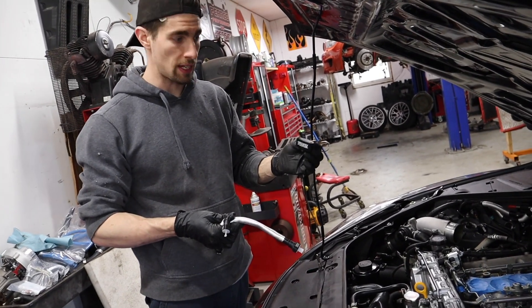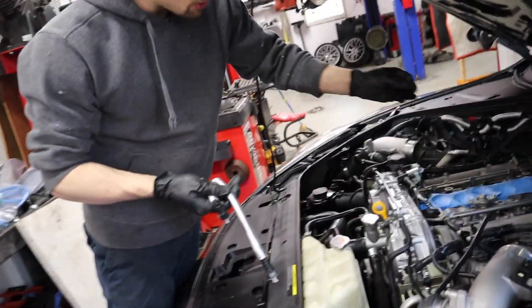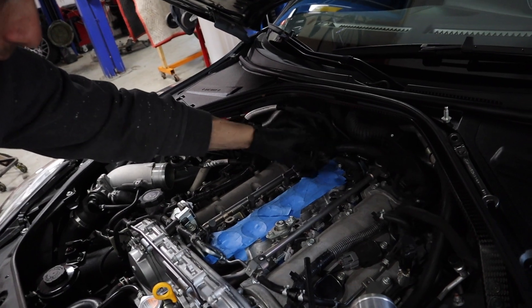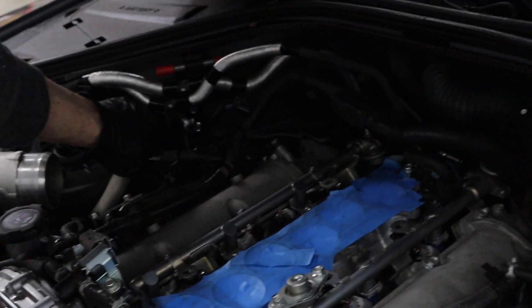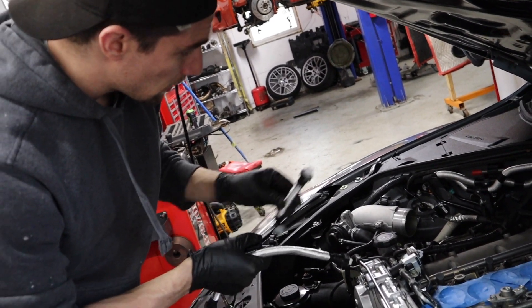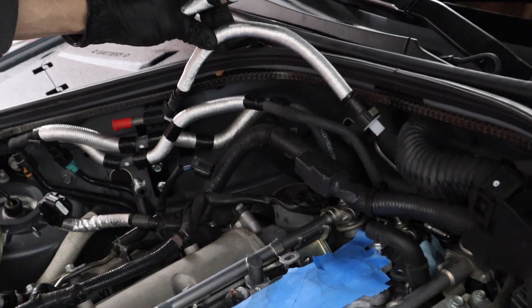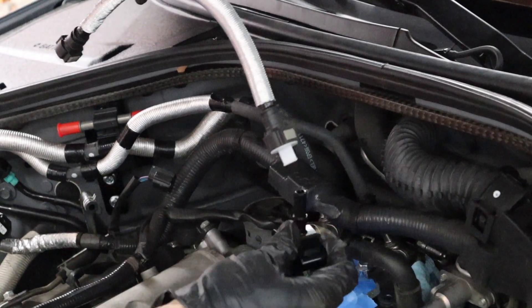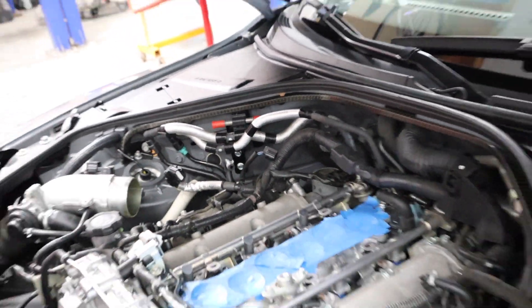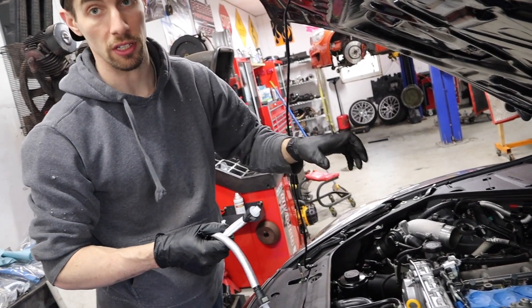We're going to be installing these pieces next — basically just an adapter and the two upgraded lines. This piece is going to go on the back all the way there in the center. We have the flex fuel sensor and the aluminum bracket mounted up there. These hoses — you're going to have one go right there, the green one, and then this piece here is going to go from the ethanol sensor basically to this piece back there on the back of the rail. Then next we're going to start removing the bolts holding on the fuel rail and pull the injectors out.